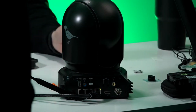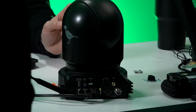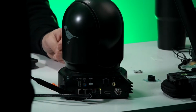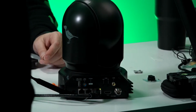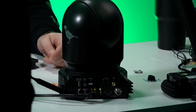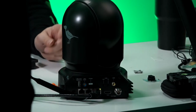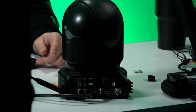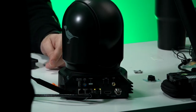The next, there's like a little switch that's right next to that. It says 1, 2, 3. This is for the IR remote. I don't actually have the P200 remote here, but it comes with a little gray remote. And that allows you to control up to 3 cameras. And this would be how you identify those cameras with that IR remote. So camera 1 on the remote would need to be switched to position 1 right there next to the rotary dial. So you change that to 1. And then if you want to use the same remote for camera 2, you would change that switch to 2 on the camera that you want it to be camera 2. And then on the remote, you press 2, and it will then control that one as well. So you can do up to 3 with the little gray remote should you want to do that.